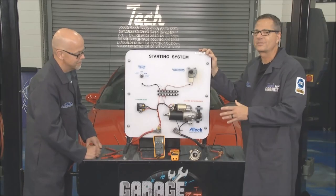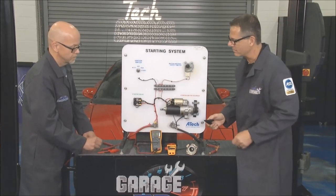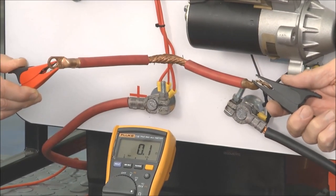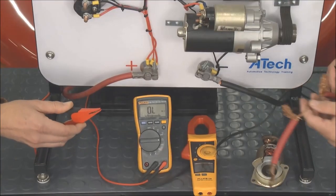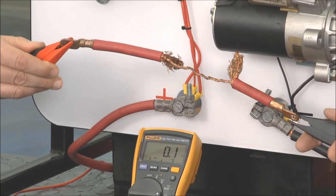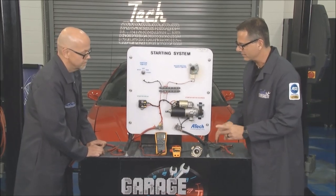Works well, but there could be voltage drops — that's something we want to check with starter systems. Voltage drops can be deceiving. If you pull that wire over here, I've got our meter set up on ohms — resistance. Across this good wire we get about 0.1. Now what about this wire? It doesn't look good at all, yet it's measuring identical. Why? There's just enough strand of wire there to conduct some electricity — that's continuity. That's why we want to actually measure voltage drops.